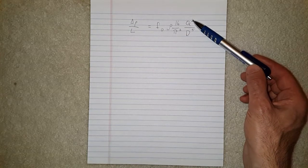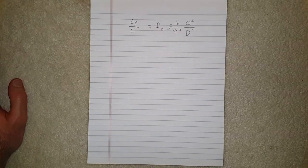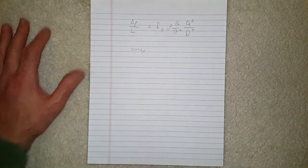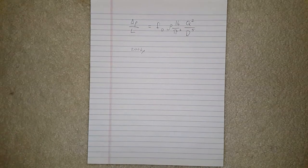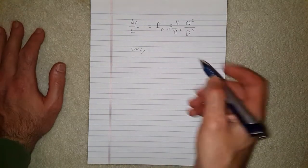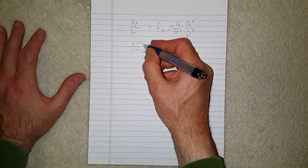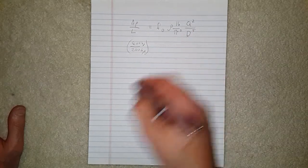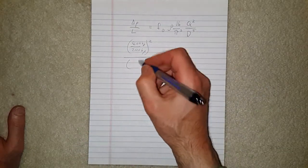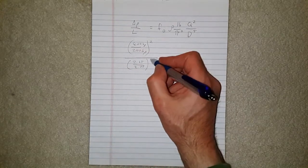The flow rate is raised to the second power and the diameter is raised to the fifth power. As an example: say a manufacturer has shipped an engine with 200 horsepower and we intend to increase it to 400 horsepower — doubling the horsepower. The horsepower is roughly equal to the amount of exhaust the engine is producing, so the ratio of flow rates equals the ratio of horsepower. We're going from a 2-inch diameter exhaust to a 2.65-inch diameter exhaust.